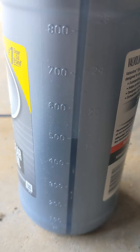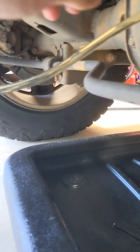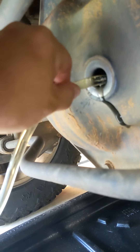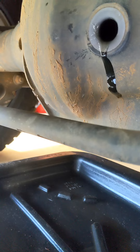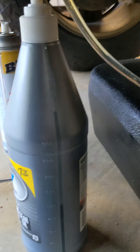When filling, I just like to see a little stream like that — now we're good. We ended up putting in a little over two and a half quarts. Let a little bit drip out, pull the tube out, let it drain back. There's the flow we're looking for — let that level out, put the plug in, and you're all done. Diff fluid changed. Save yourself a bunch of money — check the parts description below the video for a full list, and thanks for watching.